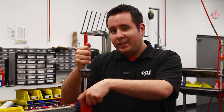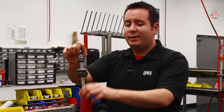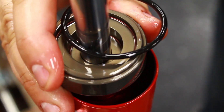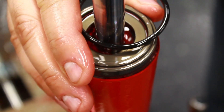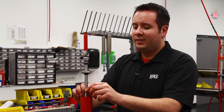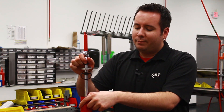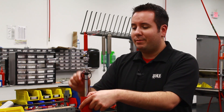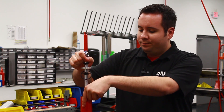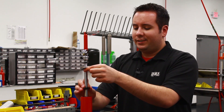Now I put my thumb over the edge of the top of the compression tube and pull the piston all the way up to the top. I'll side load the rod to keep it from compressing back down. I'm going to slide the gland back down into the shock body. You'll see the rod went down about a quarter to three eighths of an inch. Before I slide the seal down, I'm going to hold the gland down and pull up on the rod. There's a puddle of oil at the top — you want to leave that oil there because it's going to try to suck any air in if there's not oil. Pull that back up — took about a quarter inch — now I'll slide the seal down.